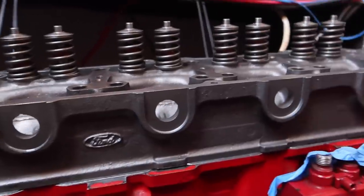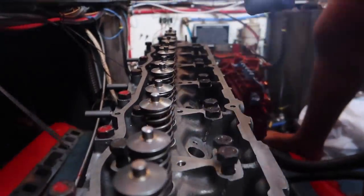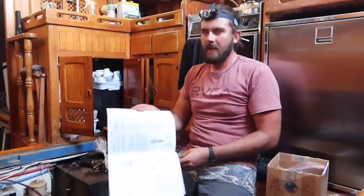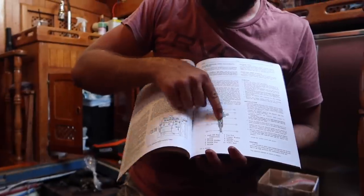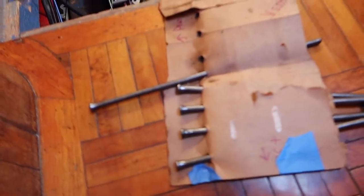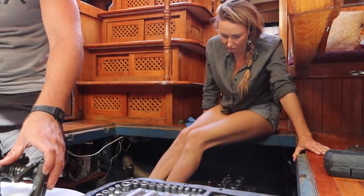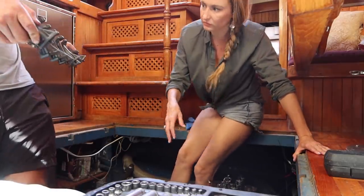We've also had the inside of the fuel injectors replaced. Now what's left to do is install the rockers — spanking new internals in all our injectors. Here is showing you how an injector looks. See this little plunger thing? It pumps, pumps, pumps. We had our old injectors rebuilt. We labeled all these so they all went in the same hole. Engine assembly hour here on the Formosa slash pirate ship. See there's this rounded end — that's the top. You need to align that.